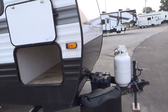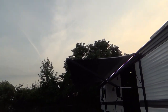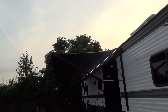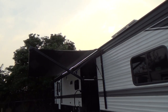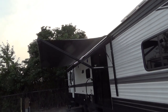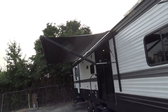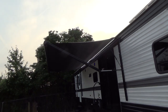Coming around, you have your awning out. Your awning is for shade control only — it's not meant to be left out in stormy or windy weather. Bring it in at night because you never know when bad weather will crop up, and bring it in when you're not around your unit. It doesn't look nice up on top of your roof — that's where the wind will take it.